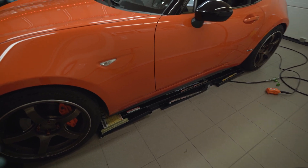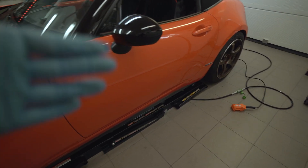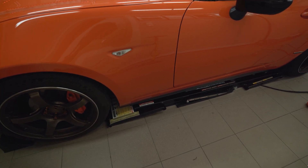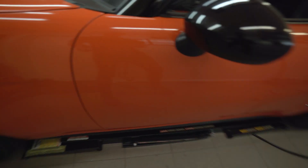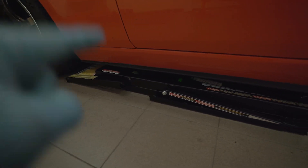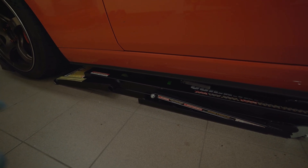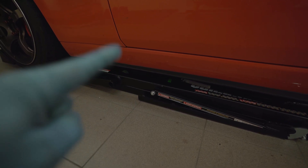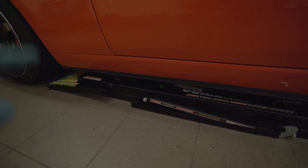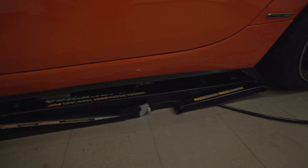It takes a little time to get used to positioning the frames in relation to the car and to each other, but if you position relative to the car they'll be consistent relative to each other as well. My only gripe is solving the issue with the shorter blocks. Now that the car has been lifted and the springs have been unloaded a little, it is actually possible to use the larger blocks — so one option is to lift the car up, lower it, swap in the larger blocks, and re-lift.